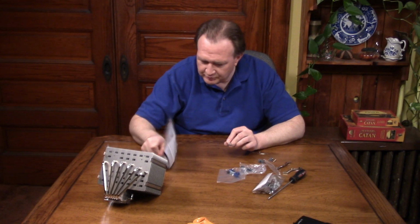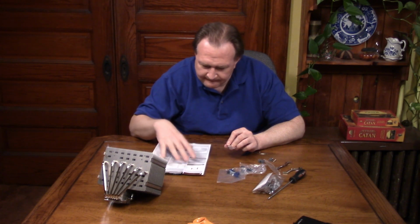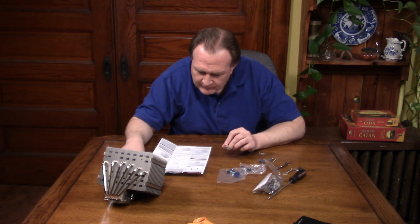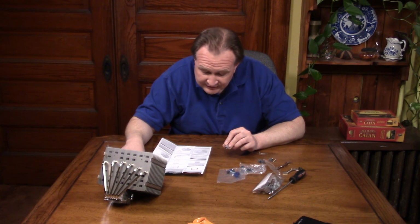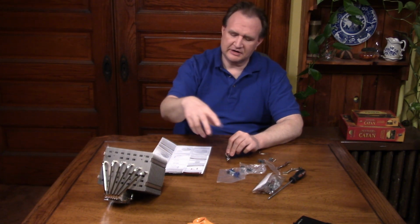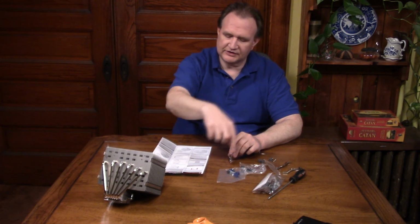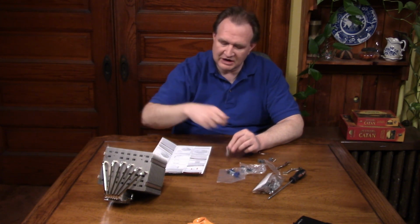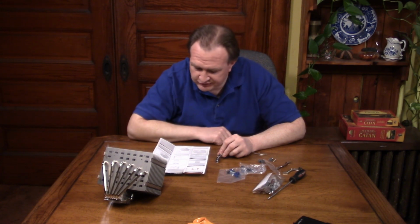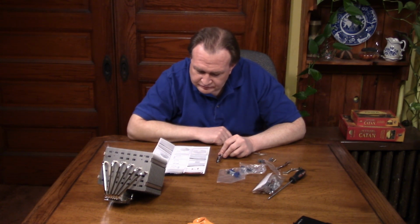And looks like you put it together, and then you put on the thermal paste. And if you use too much, it'll lower heat conductivity and cooling performance. It recommends that you put it on in 5 dots, where you got 4 small dots in the outside corners and then 1 dot in the middle. But I like to spread it out, so that's probably what I'll do.